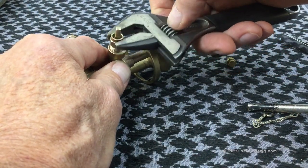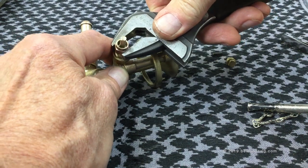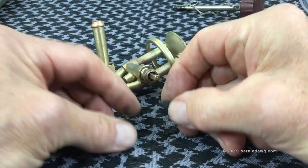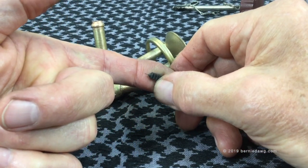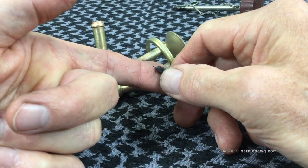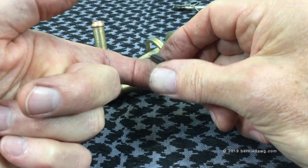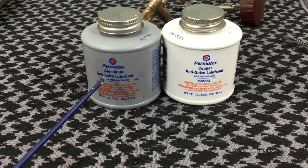Use the spindle knob to confirm you haven't over-tightened it — you want snug but not too tight. Sneak up on the proper tightness gradually. For proper operation, I recommend not installing the cleaning needle yet; get the rest of everything done and try the stove without it, adding it only after you're sure all the other issues are squared away.